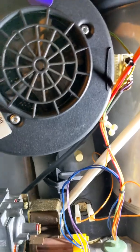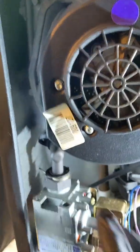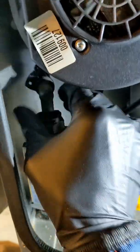So we'll change the fan over, test it, and hopefully get it up and running. First of all, make sure the power is isolated. Undo the plug connection there — the earth connection is on a little pin, you've got to press it down and pull it out. It's probably easier once I've taken the part above it out. For this connection, you don't actually have to undo the nut, you just need to remove the clip — just loosen it a touch and it will pop straight out.